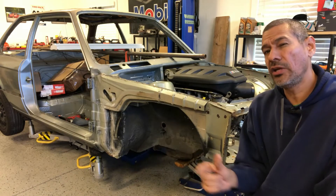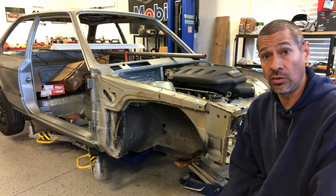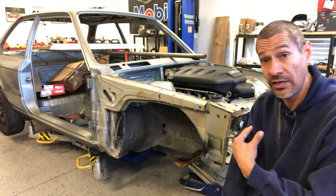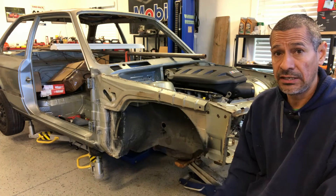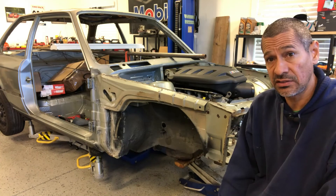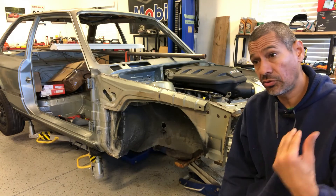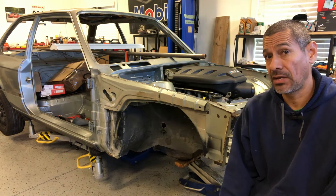I was going to do the crossmember real quick and attach it, but what I'm going to end up doing is cutting it now to get everybody up to where I'm at. At this point the real fun is going to begin, and I'll start part two of the build. My next step going into part two is cutting down the crossmember and getting that to fit in. I already have my tube here — it's just a matter of getting that to work, getting the bends in it to clear everything I need to clear, while still giving myself a little bit of room height-wise. You've got to create one item to get to the next, so I'm going to get the crossmember going and see how low the engine can technically go.